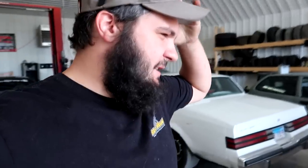All right, guys. So I just talked to the guy that owns the car, and he said that it's okay. We're just gonna tune it with the wideband that I got here, and then he's gonna either get a replacement gauge for his, because the gauge is bad. I plug in a new sensor, nothing works. And I don't have this style gauge here. I only stock the X series AEM widebands, which, like I said, I don't have as many issues with. So we're gonna be tuning it with one of those.